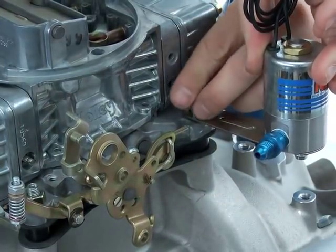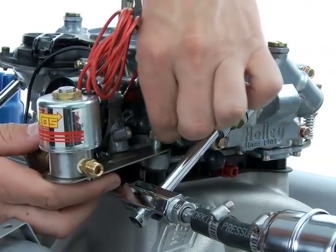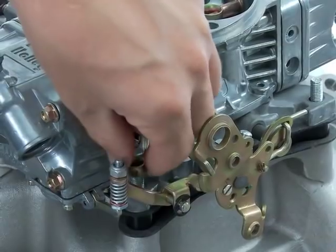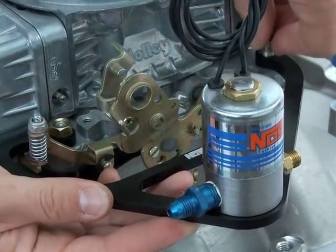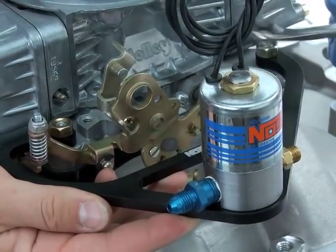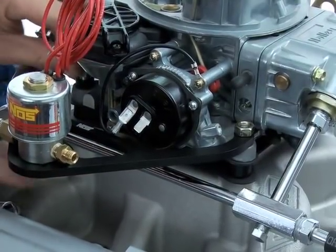In many cases, one or two of the bolts that hold the discharge plate in place will also hold a solenoid mounting bracket. If you've decided on this mounting style for your solenoids and brackets, in a minute we'll start to place the solenoids. For the time being, you can place any mounting fasteners that are not dedicated to solenoids and snug them hand tight. There are a number of specifically designed solenoid mounting brackets available as accessories from NOS. These brackets can make the job of holding the solenoids look great and make the solenoid install even easier.